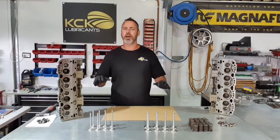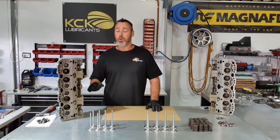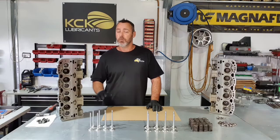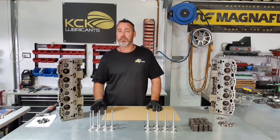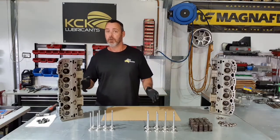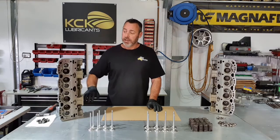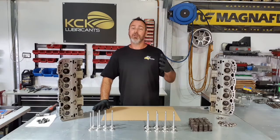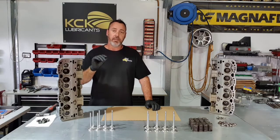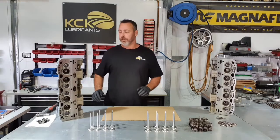We were obviously a bit sus on the cylinder heads with the amount of water they had sitting in the front of them when we originally pulled the engine down. But what we found was the valves were very badly worn, but the valve seats themselves were completely pitted. The hard facing had come off the seats and that they were ruined. So we've had to give the cylinder heads quite a big overhaul really. We cut it out, we put proper hardened seats in there. Guides have been fixed up, valves have been cut, and a good surface grind to not only get rid of all the rust off them, but to get it down to the point where the damage has been cut out from where the rust had corroded into the cylinder head itself. So we're ready to put these things back together.